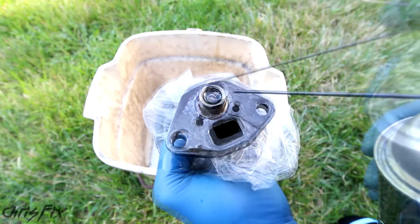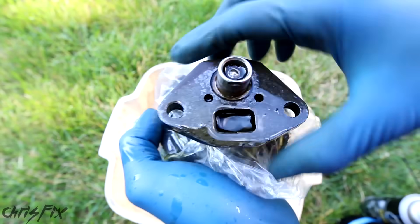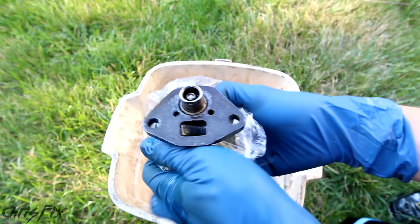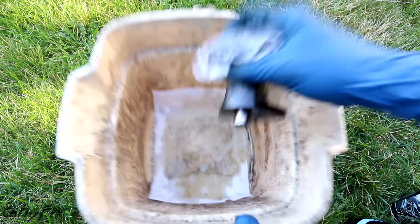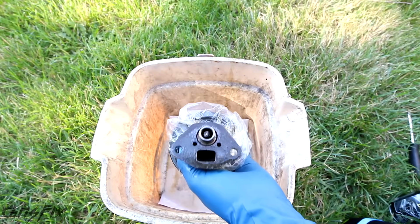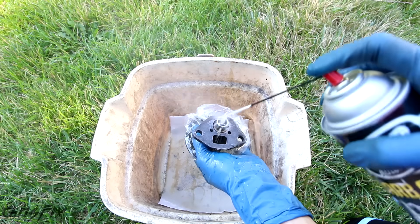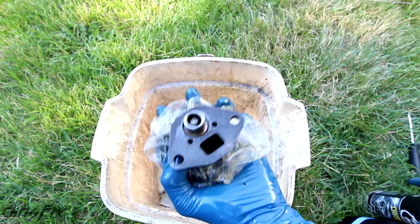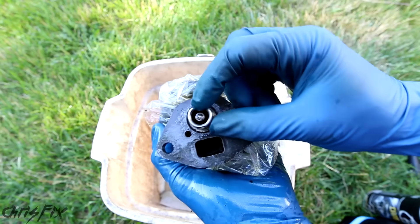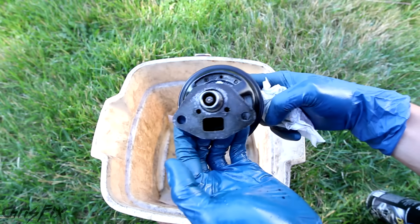A closed valve should hold liquid. Fill both the top and bottom openings with cleaner, then put it in a bucket and let it sit for 5-10 minutes to let all that carbon break down. After a few minutes, empty it out and give it a shake — look at all that carbon that came out, and this wasn't even filled with carbon. You can use a flathead screwdriver or a dental pick to agitate the carbon if it's really built up. Wear glasses to protect your eyes, then use the force of the spray to really hit this hard. That's really all there is to it — make sure you clean out the inside and the valve, then wipe clean with a towel.